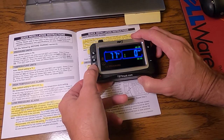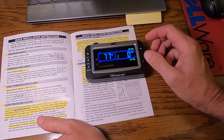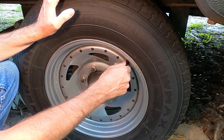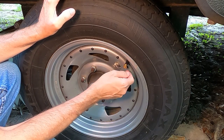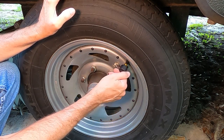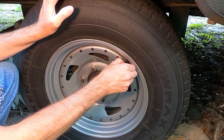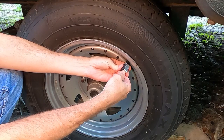Let's go ahead and exit back out. It's telling me there's low pressure because it's not hooked to anything yet. So let's go hook them up to the vehicle. First, remove the valve stem cap. Then thread on the small nut they provide completely until it stops. Thread the sensor on until it stops, then back the nut up to it until you can't do it with your finger anymore. Then use the wrench and tighten it on.